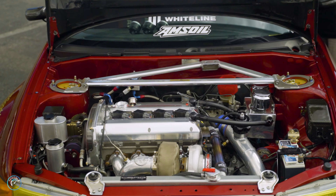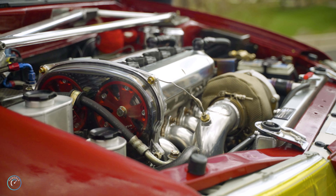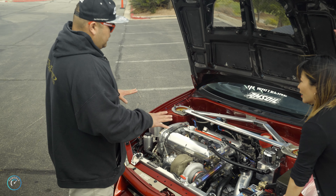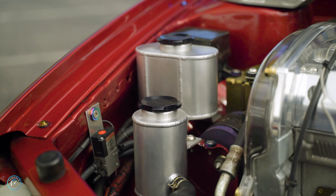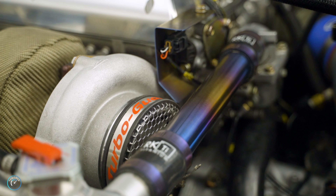Take me through that. So what we have here is a fully-converted all-wheel-drive Mitsubishi Mirage. It has a 4G63 from an Evo 8 motor. It has a billet crankshaft, forged pistons and rods. Fully built head with GSC cams. Boosting about 40 pounds of boost right now. It's on coil packs, running a Sheepy top mount turbo kit — a 64-66 turbo kit.